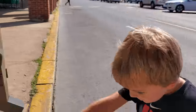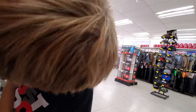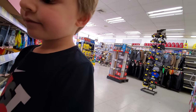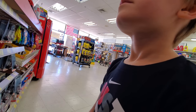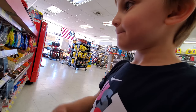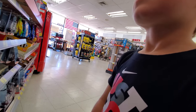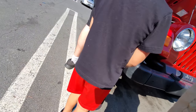I was wondering if I could get a battery installed for my Jeep. It's a 2005 Jeep Wrangler. The one in there says November 2016. But if I don't drive that Jeep in a couple of weeks, it doesn't start. Well, that's because no matter what, there's a parasitic draw on the system. Typically batteries last between three and six years. If it sits for several weeks, the best thing to have is a battery tender — it'll keep the battery fully charged, and once it's fully charged, it shuts off. The technician tests it: it's a little bit low on the cranking amps, but other than that it's good to go. So probably just get a tender for it. Thank you so much for saving me $130-some dollars.